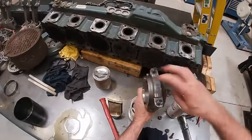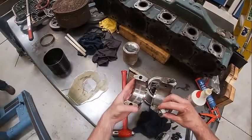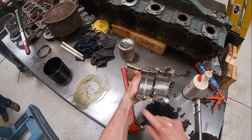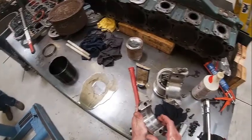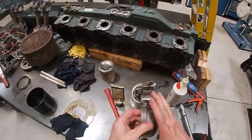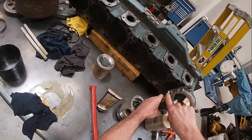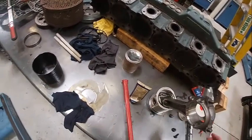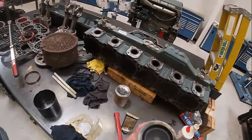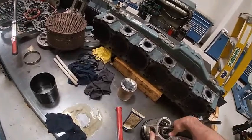I was talking about the tangs, which are here and there — you see the two tangs? Those always go together on just about every engine I've come across. It's usually the way to know which way the cap goes on. Just remember the lug orientation goes to the front. Everyone does it a little different. Some engines will actually put a front mark on the crown of the piston or have an identifying mark telling you how that works.